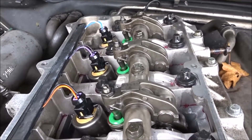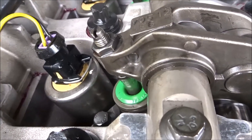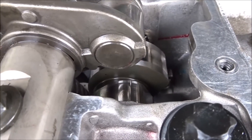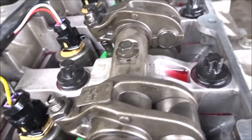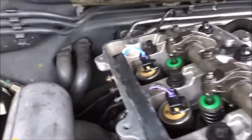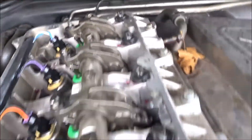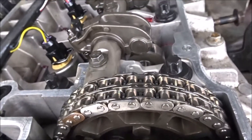All the rockers adjusted up — with the rockers you screw them all the way down to bottom out on the injectors at the maximum lift point on the cam, then you back them off one turn and lock the lock nuts up. So that's all ready to go. Just been waiting for the gauze that goes in the head behind the fuel pressure regulator, and that is stopping the start-up. Everything else is all back together and ready to go.